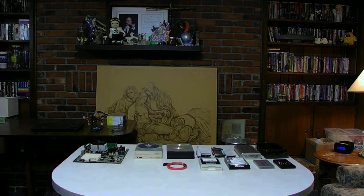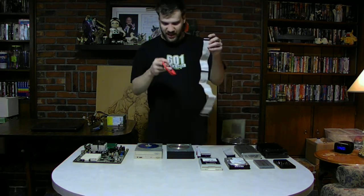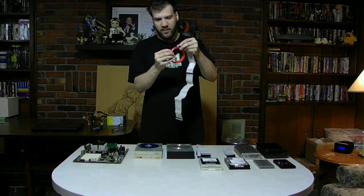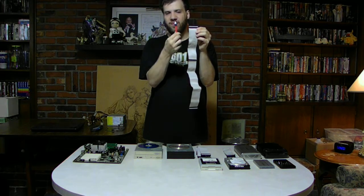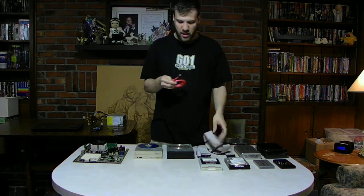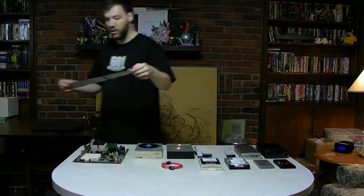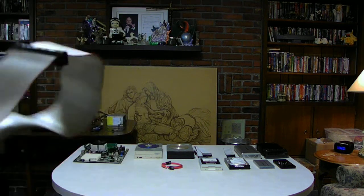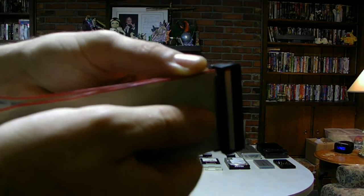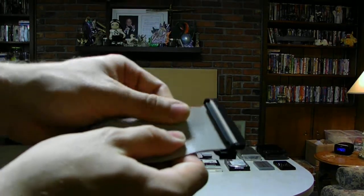The reason why I'm going with the thinner SATA cables — you'll tell the difference, guys. Which one is a whole lot thinner: the 40-pin ribbon cable, or the 7-pin SATA cable? This is the smallest one versus this one. The SATA cable is tiny and can fit into smaller areas versus an IDE ribbon cable. On one side of the IDE ribbon cable, you've got a red stripe on one of the wires — it's all individual wires.